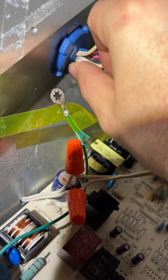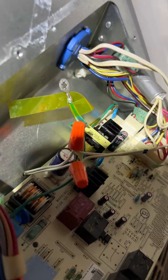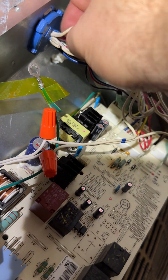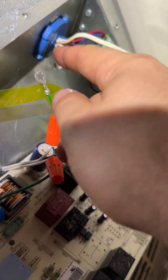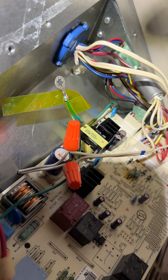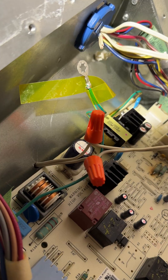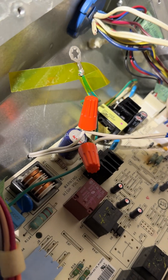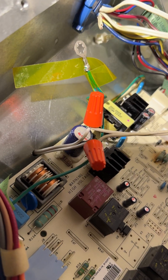So to this conclusion I came after messing around with a bunch of stuff. There are three thermistors coming out of this cabinet: one on the evaporator coil, one inside the refrigerator, and this one was inside the freezer. After reading the value of the thermistor right at the actual thermistor — I poked holes in this wire and checked the value — it was showing perfectly fine, from about eight kilo-ohm to about four kilo-ohm, depending on the temperature.